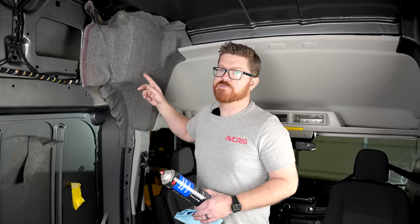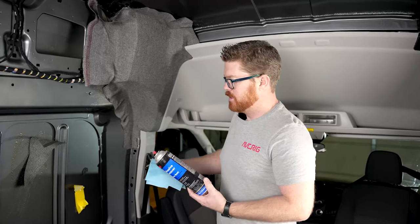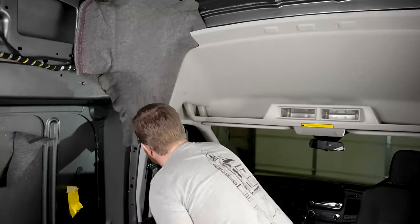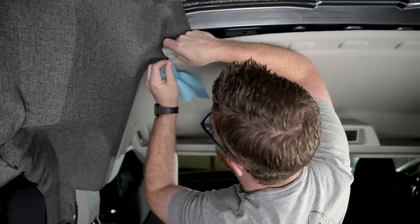With our second wrap complete and we're happy with the final product, we can clean up a little bit of residue that may have gotten on some of our plastics. We use this 3M citrus-based adhesive remover — it's not going to white out or dry our plastics out. If you're building a van, it's a really good investment; one can is gonna do pretty much your whole job. We just spray a little on the residue, let the adhesive activate for a minute, then come back and clean it up. And you are all done here. Please subscribe to our channel, find more tips and tricks, and like this video so that others can find it. We'll see you on the next project.